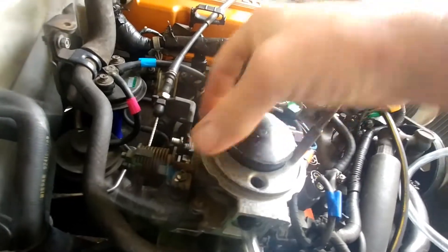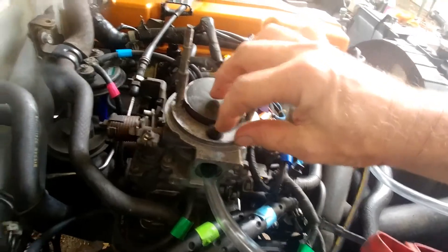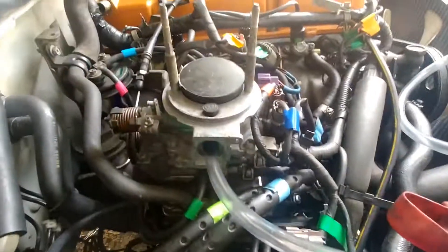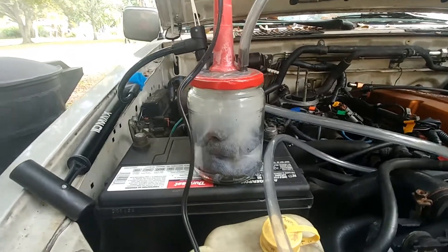On the top, to plug up the other two holes, I've got a number 12 rubber plug and a number 000 plug. That'll get everything sealed up. When the smoke comes through, it'll go into the intake manifold. I'll plug it in now and start filming again when I look for the smoke — and we've got smoke in the smoker.